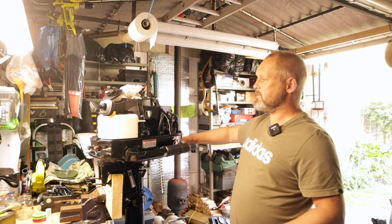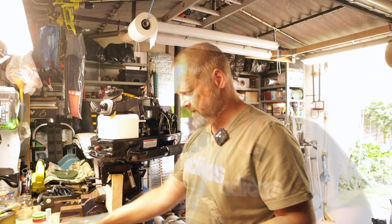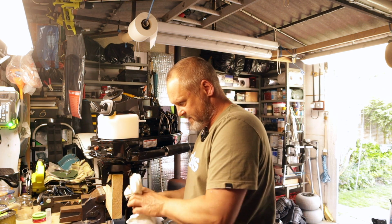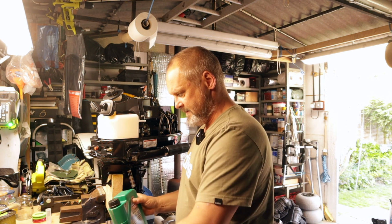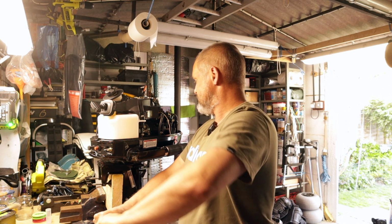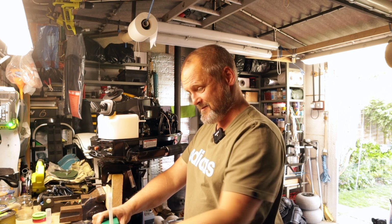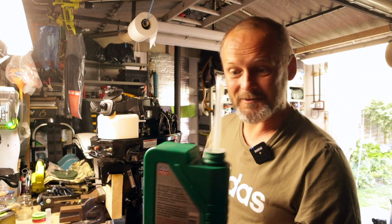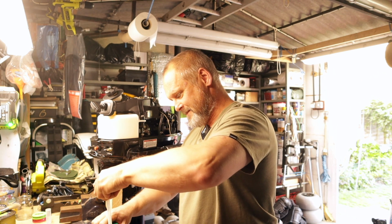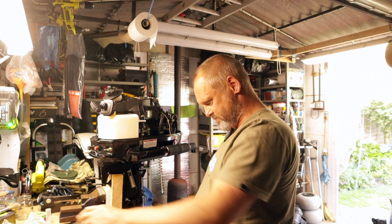Okay. So, the manual says 650 millilitres of oil to be replaced. But like I say, we've got this Liquid Moly to go back in. Looking at the front of it, I think it's got a nice little nozzle, which it has. That's cool. How cool is that? Look at that for a nozzle. Very nice. Located. And it's got 100 ml graduation.